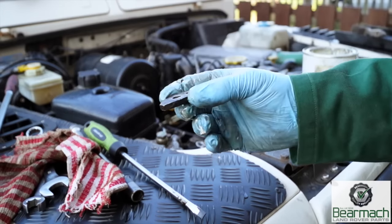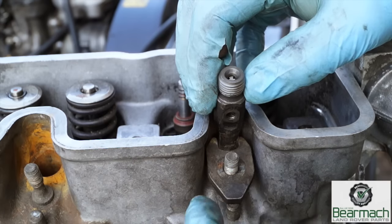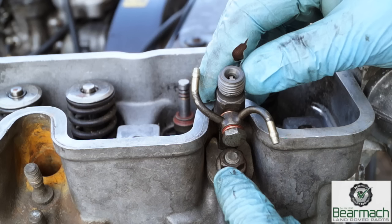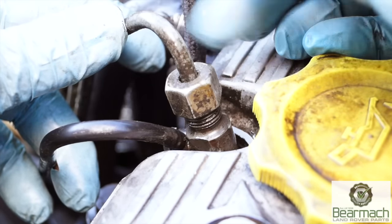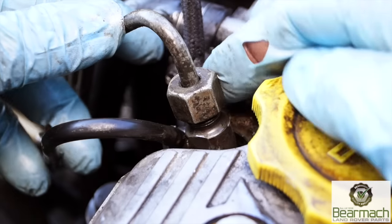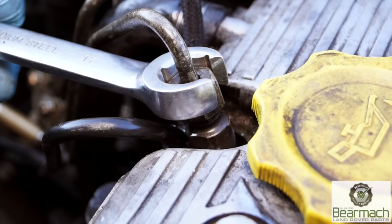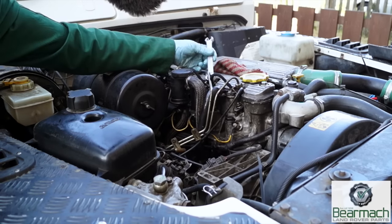The clamp only goes on one way, so it's fitted with the heel lower. Basically you slide the injector down almost all the way, then fit the clamp on. The nut is done up to 25 newton metres. When you're fitting the spill rail back, ensure that you also have fresh copper washers fitted to ensure that they don't leak. Make sure that the pipe fits snugly and the unions are held in place before you tighten the nut down — finger tight first. This will ensure there's no damage caused. Otherwise you'll find you'll have to change the injector pipe to stop any leaking. Once you've got the engine running, just make sure that the injectors are clamped down properly. Otherwise you'll find they'll be blowing and knocking.